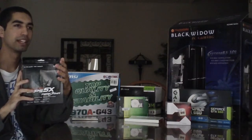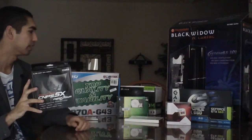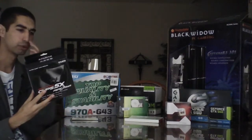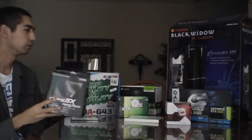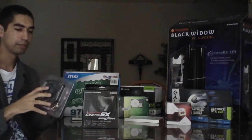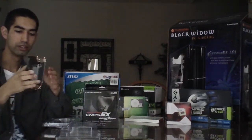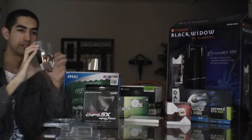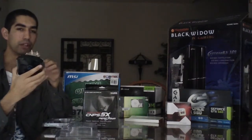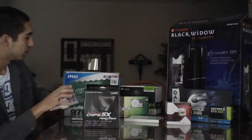Because of the higher TDP it will run hotter, which is why I'm going to use an aftermarket cooler. I tried using the stock cooler and while it worked and kept it cool, it's noisy and driving me nuts. So I'm going with this Zalman — it was like a $20 aftermarket cooler. It's got a couple of copper pipes — three of them — so we'll see if it transfers heat well. It's got a nice fan that'll help blow air out the back of the case.